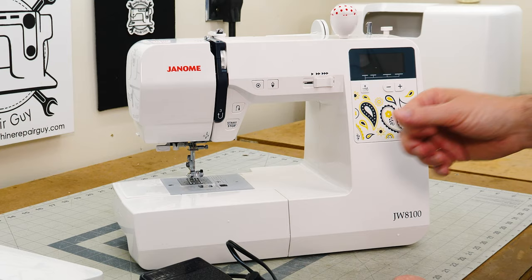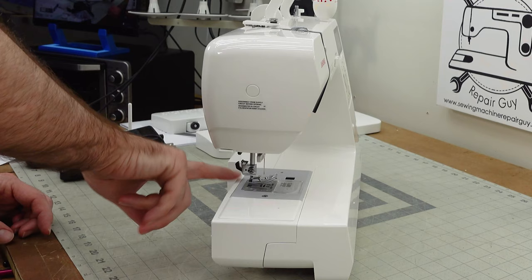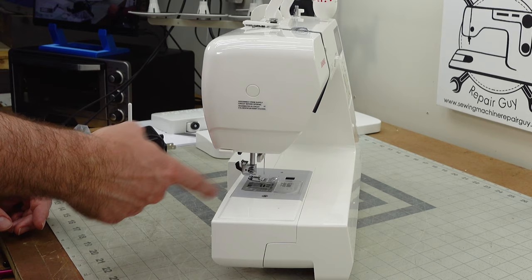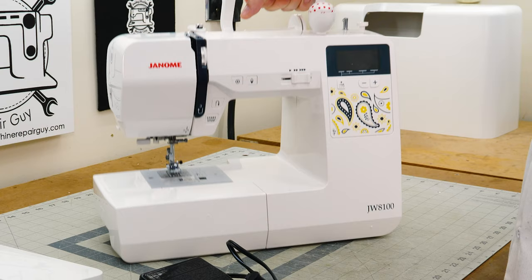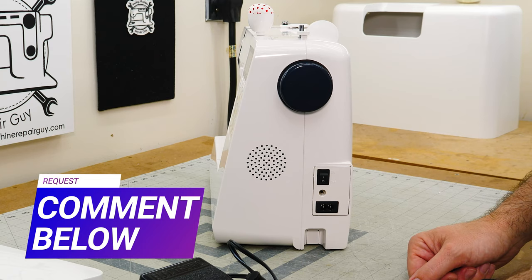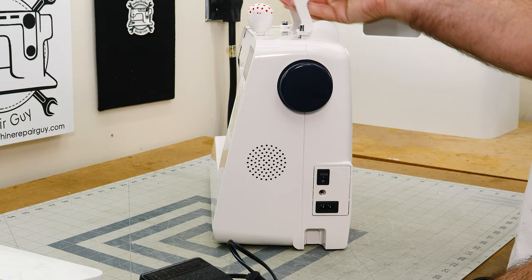It does come with a needle installed. Looking on the back — pretty straightforward. This is the switch right here. You've got to watch out when that switch is there — if you switch that, you're going to drop your feed dogs. So if you're ever using your machine and the feed dogs drop down below, they won't move your fabric. You have probably hit that button on accident. So do you ever use that? Do you do darning or free stitching where you drop your feed dogs? Put a comment below — I'm curious because I personally don't think many people use that, but I could be wrong.